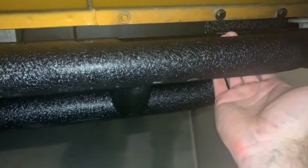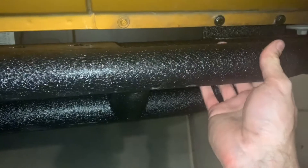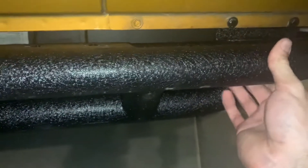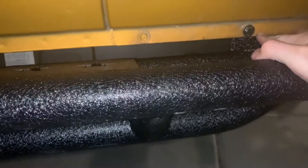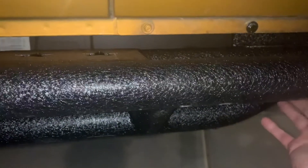We have it all bolted in now. We've got all the top bolts in - all four of them - and the larger underside bolts in as well. What I'd recommend when you put this in: obviously you need the top ones in to hang it, one on each side, then run them all in and put your lower bolts in. What I did was run the lower bolts up so they're just barely engaging the lock washer with just a little bit of play on each side, then tighten the top bolts pretty much all the way up, then run the bottom up a bit more - still engaging the lock washer but left just a little bit loose.